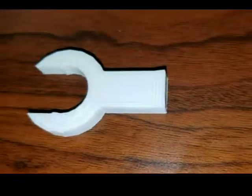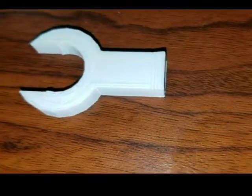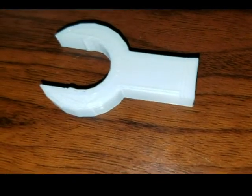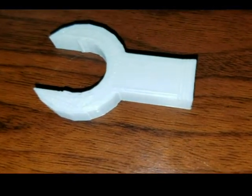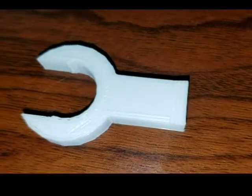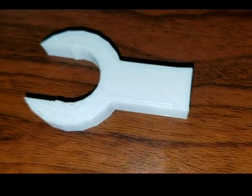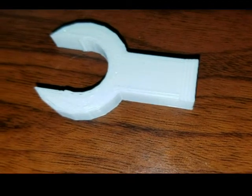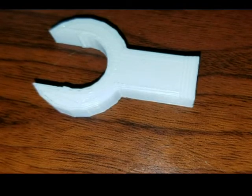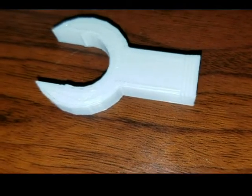So the problem is the refrigerator door isn't closing. So I printed up a shim to go on the, I guess, the pin on the bottom of the door to elevate it because it's binding. If you have a binding door on your fridge, it's probably caused by a little plastic washer down there breaking out or disintegrating or getting old or someone hanging on the door.